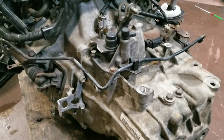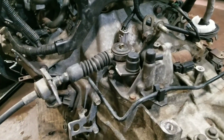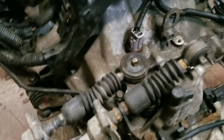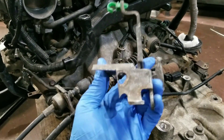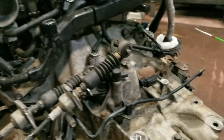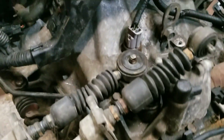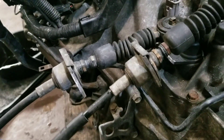First thing you want to do is locate your shifter cable and put it on where you think it should go. I have mine positioned where it's gonna go. What I did is I took my original bracket and cut off the mounting slot. Then I located it back onto the cable, and what you really need to do is find a measurement from this plate to this point, centered for your mounting location.